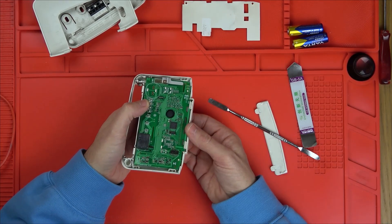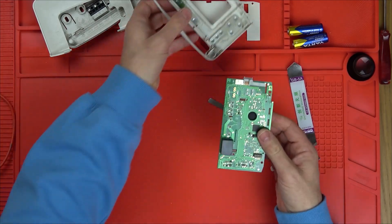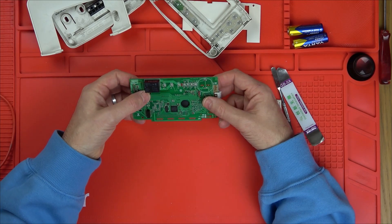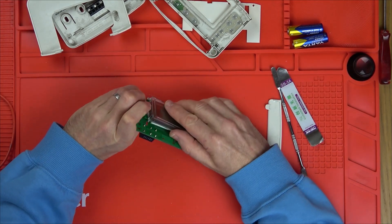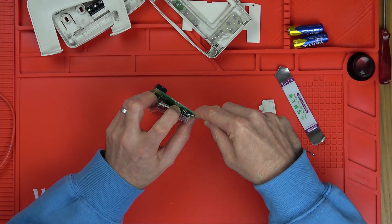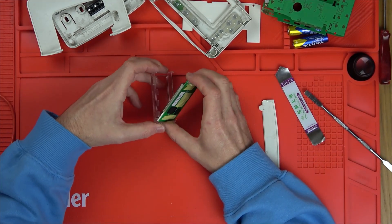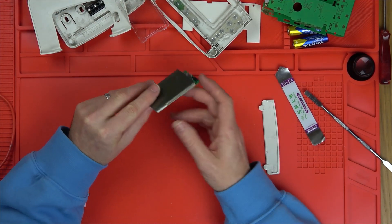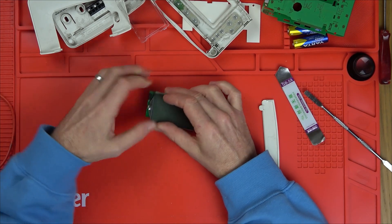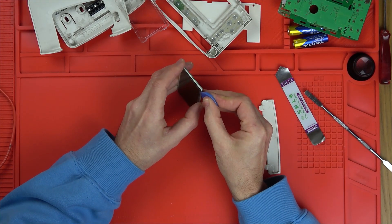They're loose. There are two little posts here that we need to lift it up quite straight from — it's a bit fiddly, but if you try to lift that bit up there, then it will pop out like so. Now we can take the screen off. I'm just going to use my thumbs and push in these little catches here and also up the top, and that will lift up via these pins, so I'm just going to gently ease up on here. I want to take the plastic away from the screen. This here is the cable that's gone faulty. So we're going to try to lift up the screen and flip it open to get to the cable so we can try to melt the adhesive again, but it will be attached on this side down here. I'm just going to use a plastic pry tool to go in here.